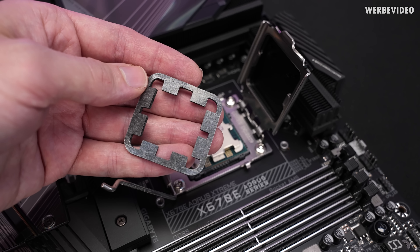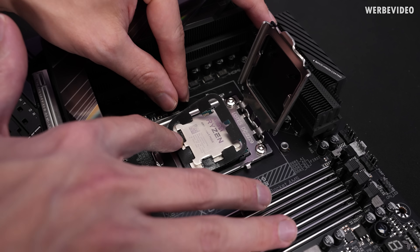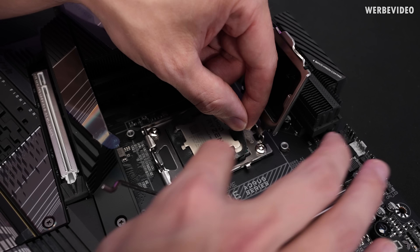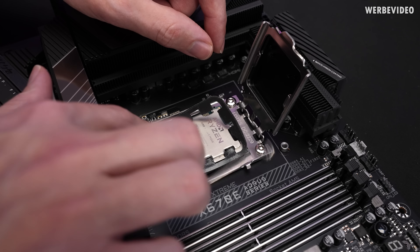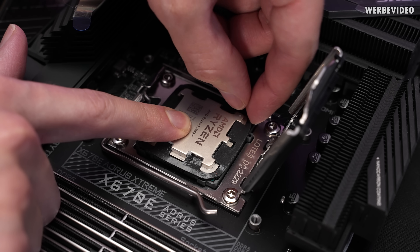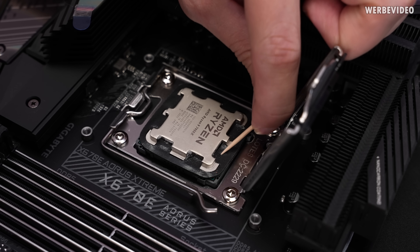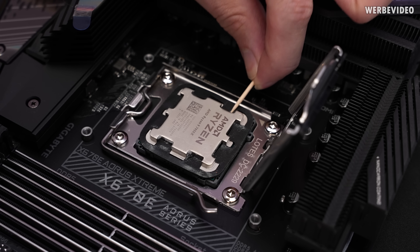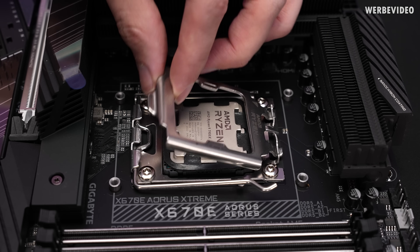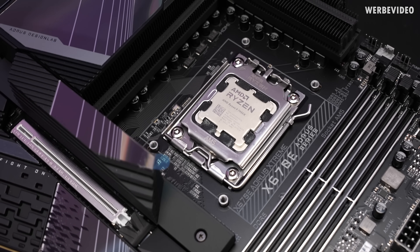There's a protective film on the back and a sticky surface underneath, which can be a bit annoying since it's very thin. Take your time and pull it into the notches — it's usually best to start with the edges first, get them aligned, then fix the center parts. A toothpick is a good tool to push it inwards. In the end you just close the socket; it's a very compressible material by about 80%, so closing is no problem at all, and the CPU is protected and ready to go.